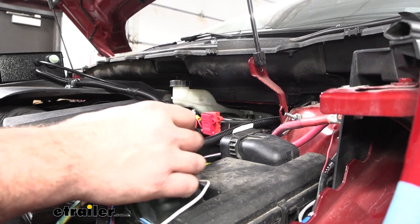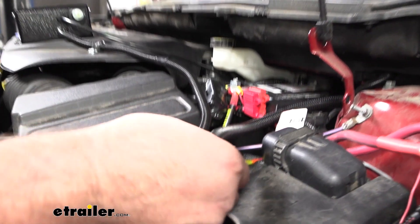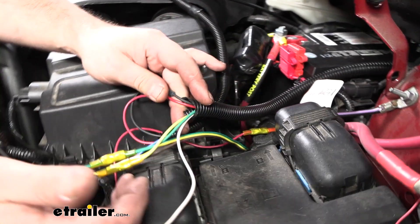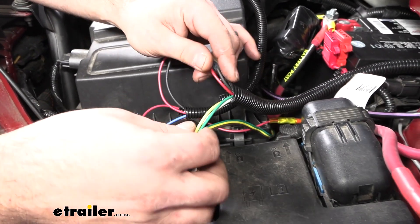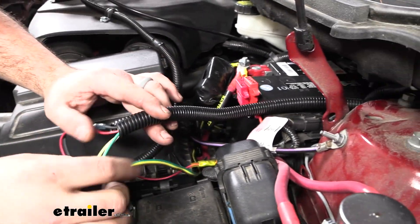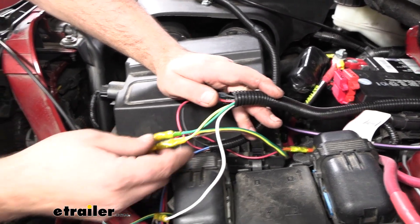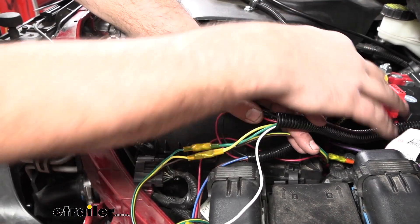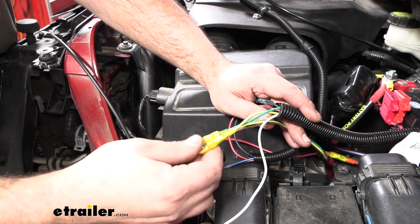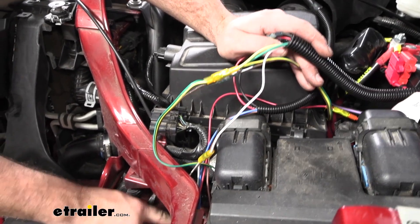The red and black wires from the main unit attach to the red and black wires coming from the G-Force controller — two of the five wires off the G-Force. The other three — green, yellow, and white — feed from the G-Force controller and had to be routed through the firewall. They tie into the diode wiring, so if you're running diode wiring at the same time, pull up an extra loop to make that connection easy. We also have our ground, split off using a factory ground located nearby.